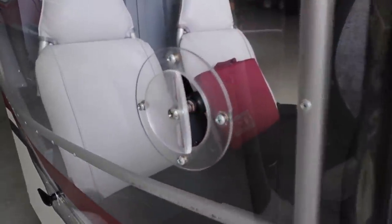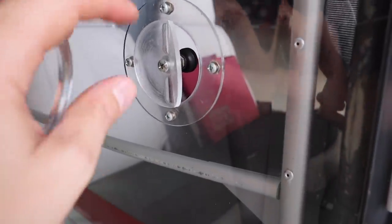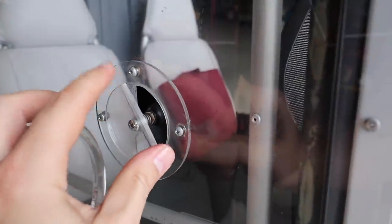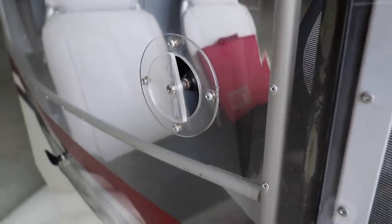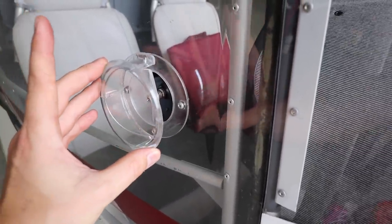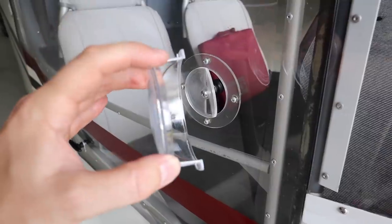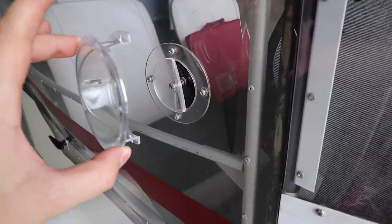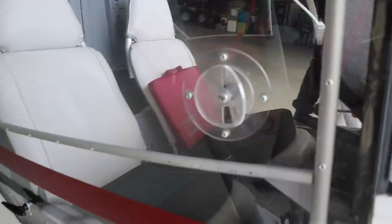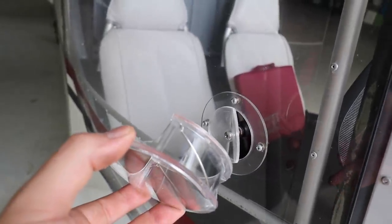One of the other things we're going to be working on is these vents. These vents may have been okay for the more northern latitudes this airplane used to be at — they're just a little rotate item, you can rotate them from inside the cabin to shut them on and off. But down here in Texas I have a real fondness for these big snap vents that Aircraft Spruce and a few other places sell. They're much bigger and they'll duck out and catch air — really put some air in the cabin. I had them on the kit fox and really liked them. So we're going to go ahead and replace these, cut our holes a little bigger, and snap these guys in their place.